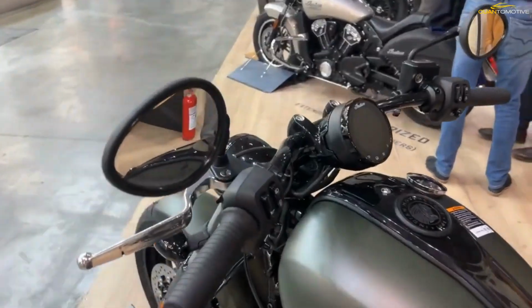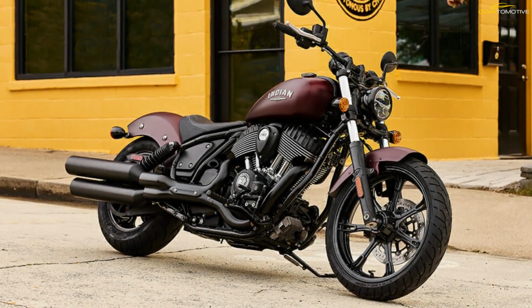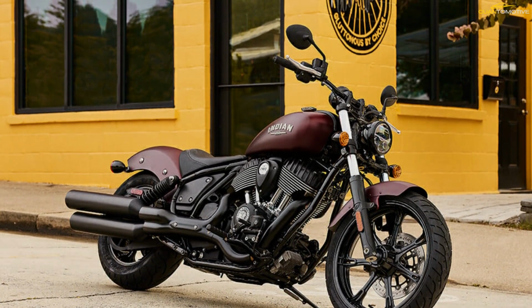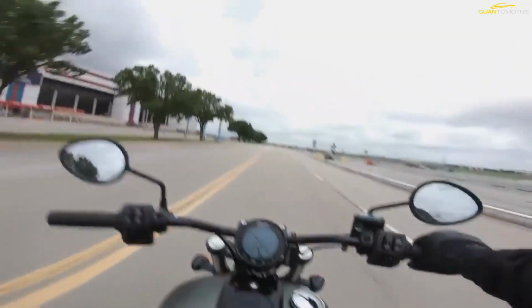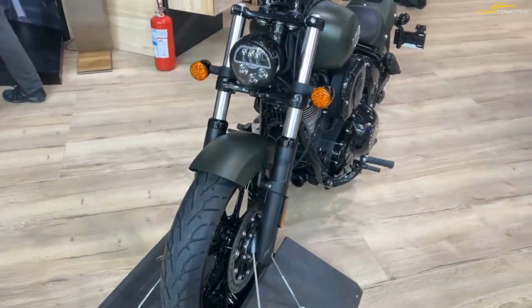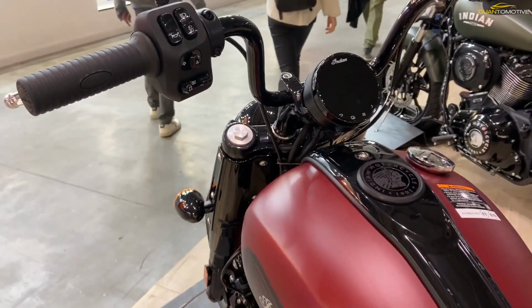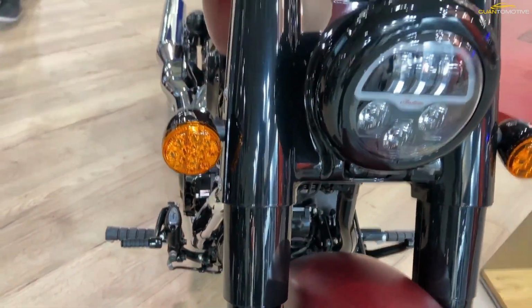It only has spring preload adjustability, but it's worth taking a minute to appreciate the fact that a cruiser has prioritized suspension travel over low seat heights and actually given the back tire a chance to move up and down over bumps instead of blowing through the shock travel immediately and jolting the spine. If compression and rebound adjustments are important to you, the Indian catalog has a set of upgraded Fox shocks that give you that ability.